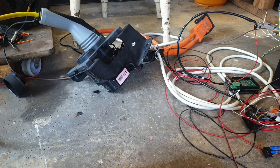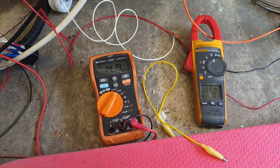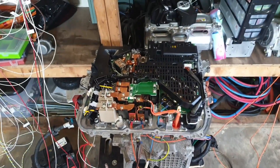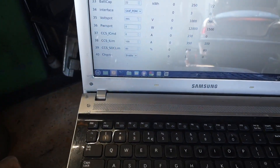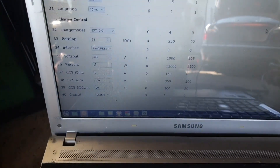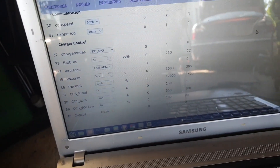I'm going to plug in the EVSE — but no charging yet. We're not hearing the click from the PDM, and the reason is that we're currently commanding a zero power state from the PDM. If you look at the web interface here, you can see we've got zero power. So let's go ahead and ask it for some power — let's go for 1000 watts.